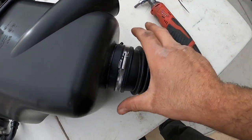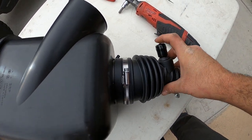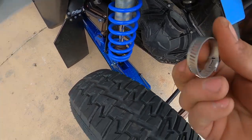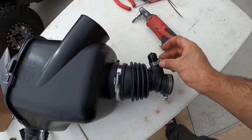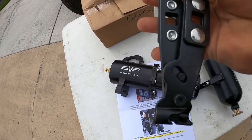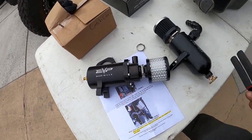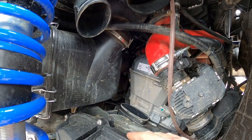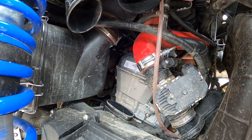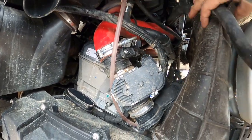I'm showing you this on the intake box I have here since I'm converting my 2018 X3 to the 2020-style intake box. Both RPM and EVO give you a cap for that port — you cap it off and run a hose clamp using the factory clamp that was on the original hose. For the EVO version they include one of their spring clamps that you install with a special tool, which I'll link in the description. You also need to cut a couple zip ties holding the harness to pull the hose to the other side.